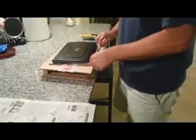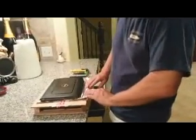Hello, we're going to go over a screen replacement on a Dell Latitude ST tablet, model number T02G. Here we have the screen that was damaged, and we got a replacement in for it, and here is the tablet. What you want to do first is turn it upside down. Make sure you have it powered off to begin with. Turn it upside down and put it on a soft surface. I set it down on the box and the anti-static pad that it came with.